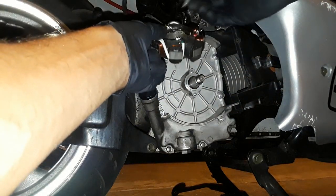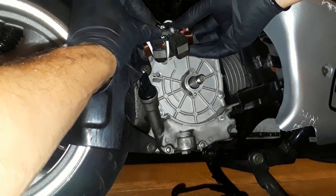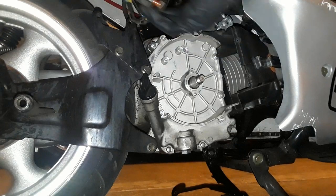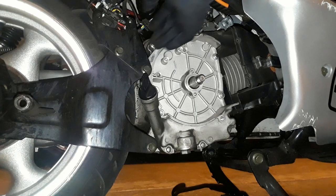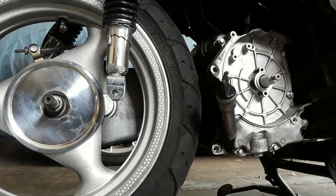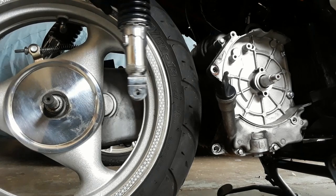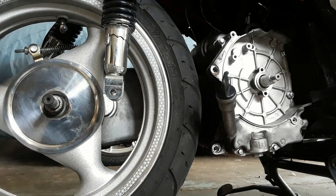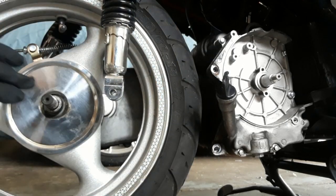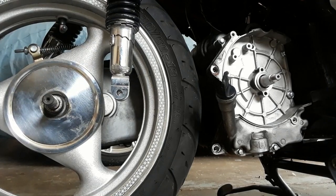We're going to move that old component with screws intact and put that near the tire. Before we go any further, I do want to mention — if you look here on a non-rocket style Chinese scooter, you normally have a black swing arm that connects from these two bolts all the way back to your tire and the shock in the back. That needs to be removed before we proceed.